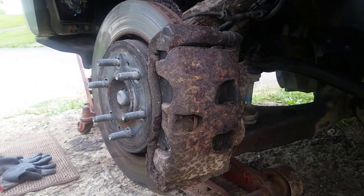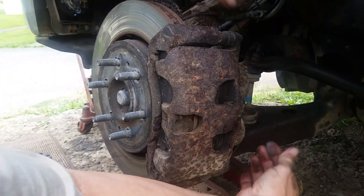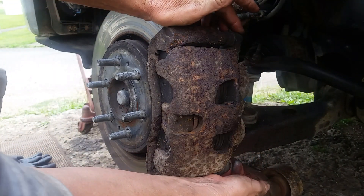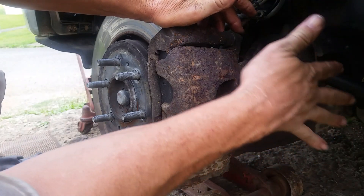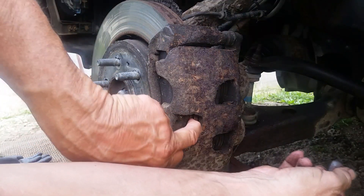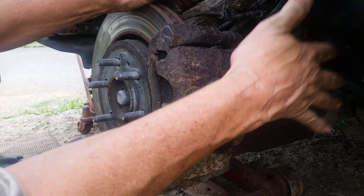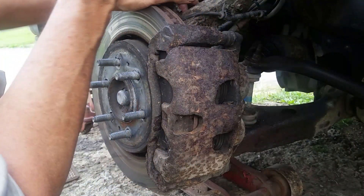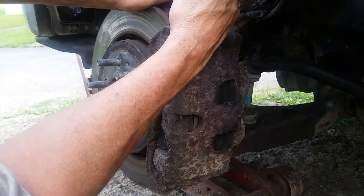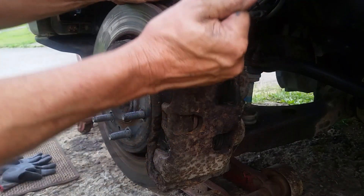So having said that, we're going to try and get this off here. Looks like these bolts back here are probably 12 or 13mm and there's only two of them - this whole thing just sits on here and floats. I need to check the brake pads anyway, although they look like they might actually be pretty good. Let's see if we can get this off - I don't know how well my attempt is going to be, but it might be successful and save myself a hundred bucks.